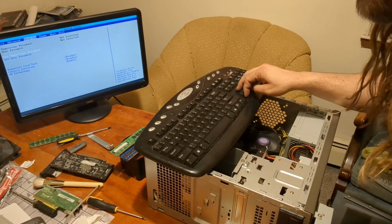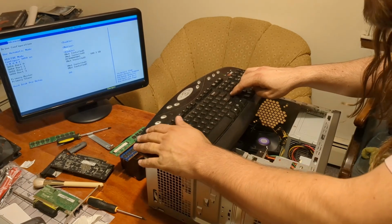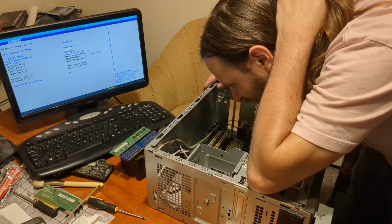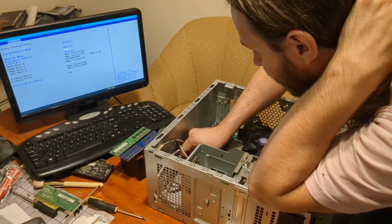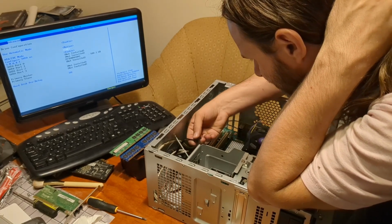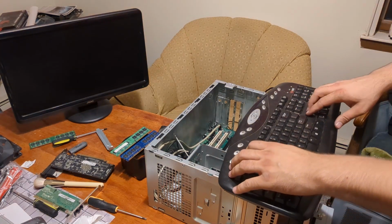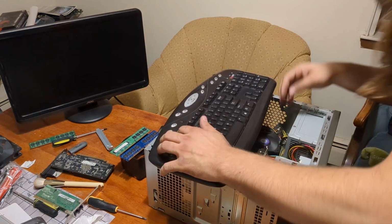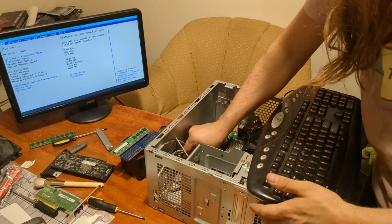You know what? I have an idea. Oh, here we go. Okay, SATA port 0, 1, 3. This is why I need my hat. We're plugged into SATA 2 for the hard drive and SATA 0 for the DVD. So we're going to just try moving ports. Okay. Wonder if this is a bad DVD drive. I don't think so. Oh! Ha! SATA wasn't plugged in on the DVD drive. I thought I had it, but it wasn't. We're going to put this back in its original spot.